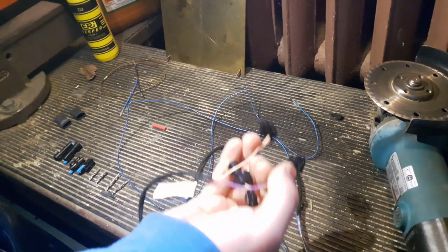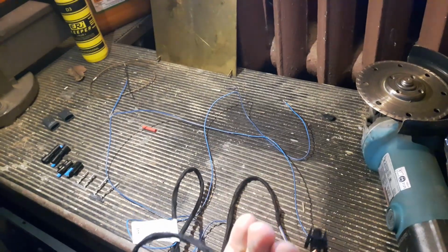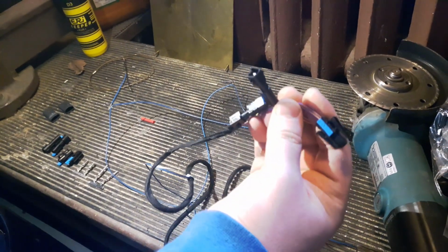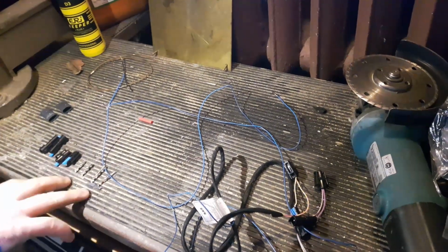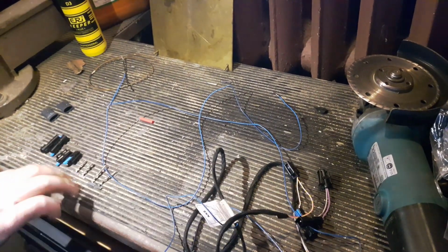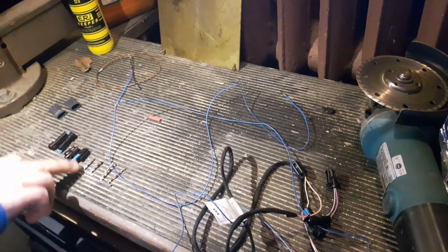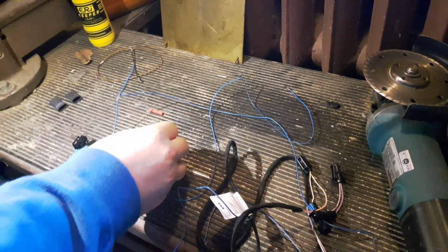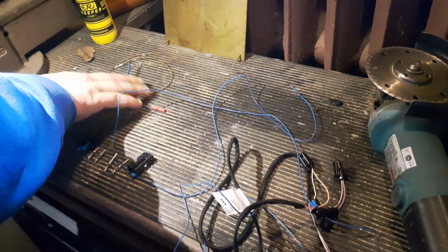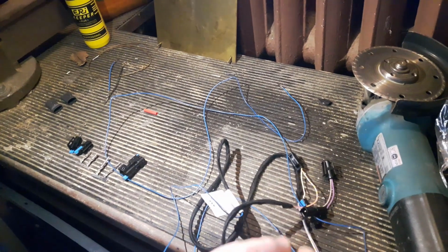And then this is all the wires you need. And this comes like this from the kit. These are the two wires you need to cut, and here's the equipment for the cut wires. You can plug them here, two long ones, males, and then two short ones, females, and these go to here, the corresponding long and short versions like this. The kit comes with spare wires, but we won't need those if we don't mess something up.